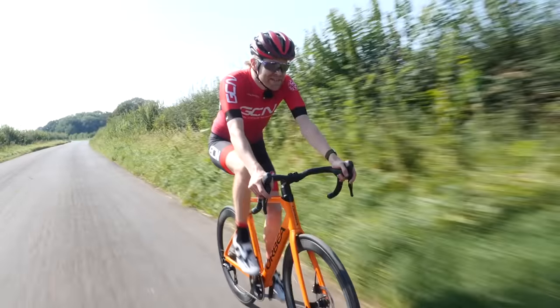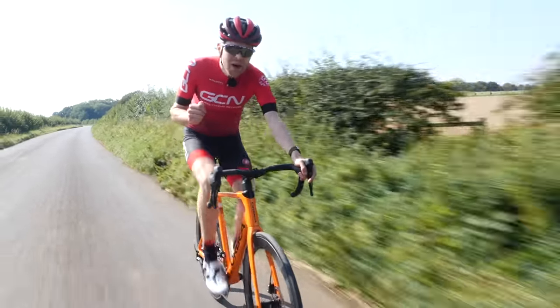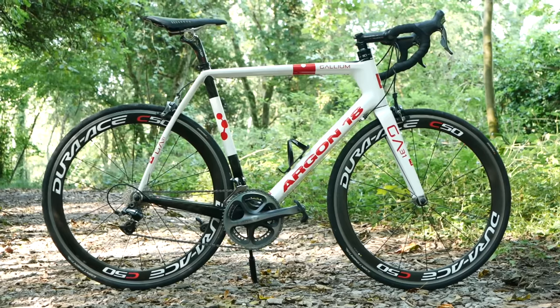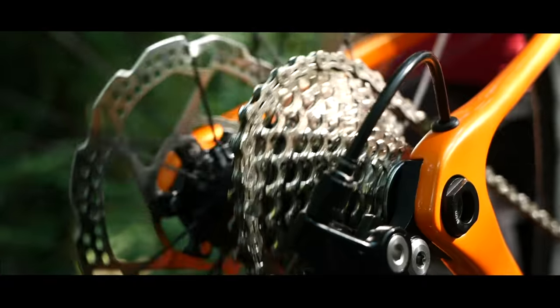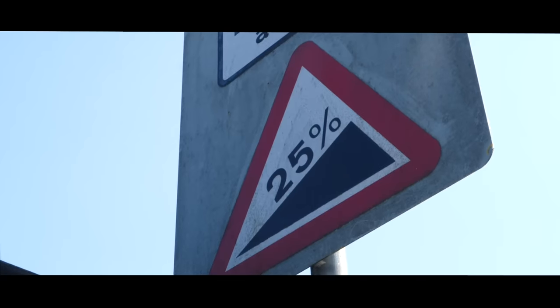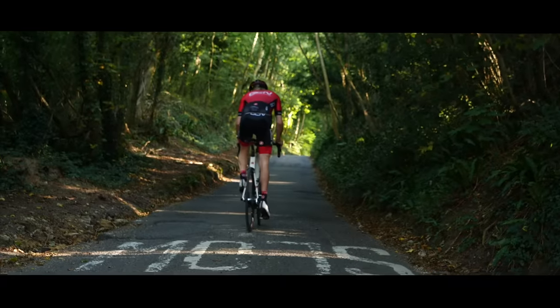And with that in mind, we decided to get this, the latest Shimano 105, and see how it compares to Dura-Ace from over 10 years ago. This climb is an absolute wall, and I'm already in my easiest gear.